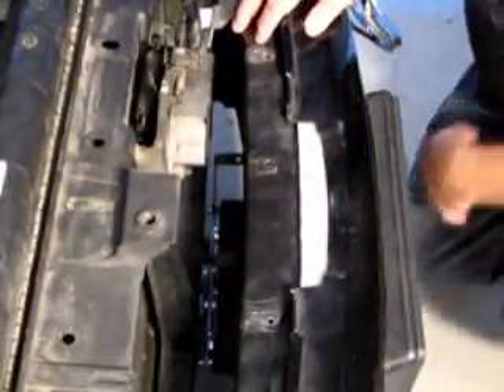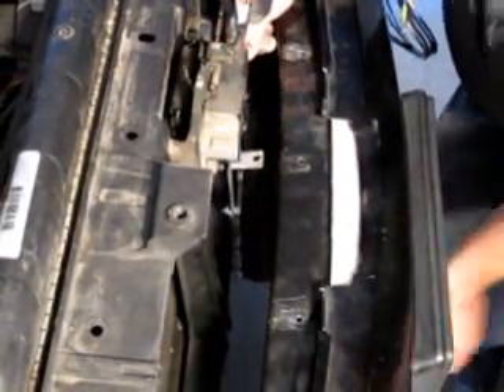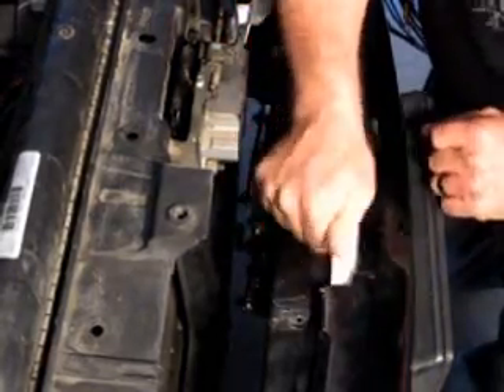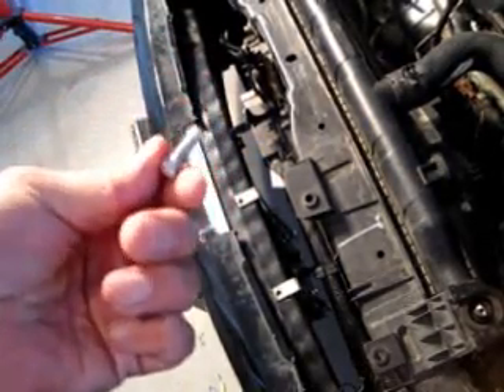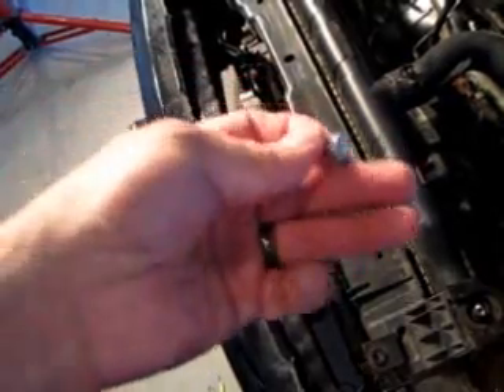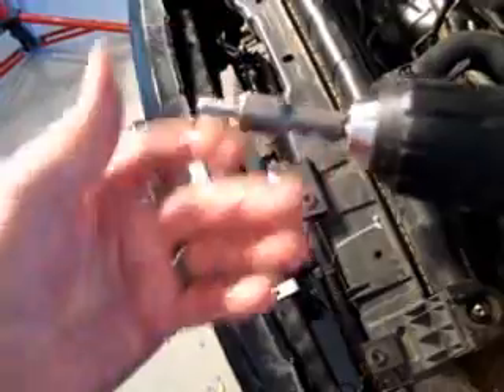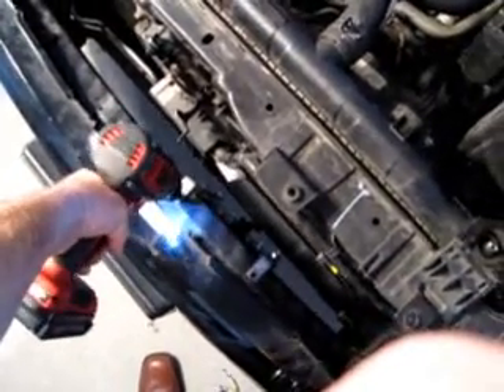All I have to do is get down here, grab the bracket, and pull this front bumper out just a little bit so it can fit — it's a tight fit. This front bumper beam is metal, and we take our screw and screwdriver and tighten that up. What we recommend are metal self-tapping screws. Drill a hole in the metal — it's actually pretty thin — get a socket driver that fits and put it in your screw gun, then put it in the hole you drilled.